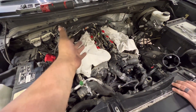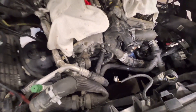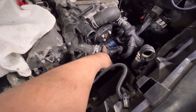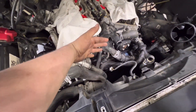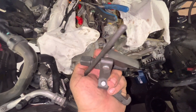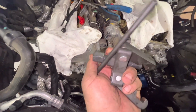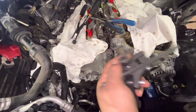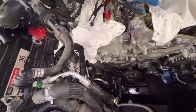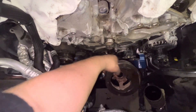Quick update: intake is off, both valve covers are off, now ready to tackle the timing cover. I'll start by removing anything in the way - this bracket, the thermostat, water pump, these pulleys, and anything else in front of the timing cover. You are going to have to remove the crank pulley - you'll need a puller. The bolt is 18 millimeters. You run this rod down the center and it presses the pulley off the snout of the crank - it comes off easy just like that. I'll link the puller in the description.